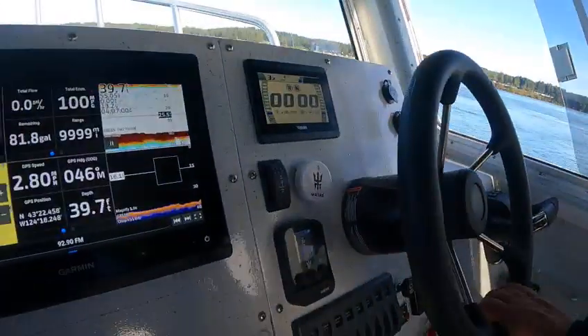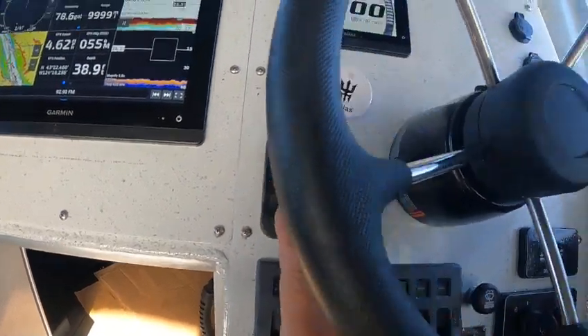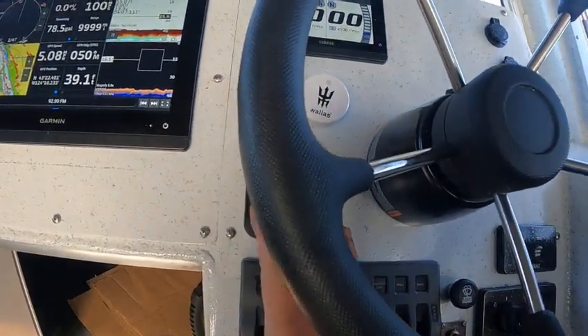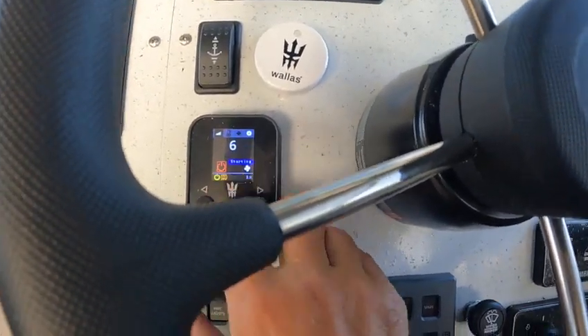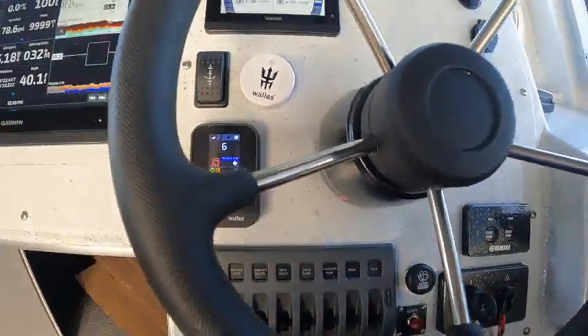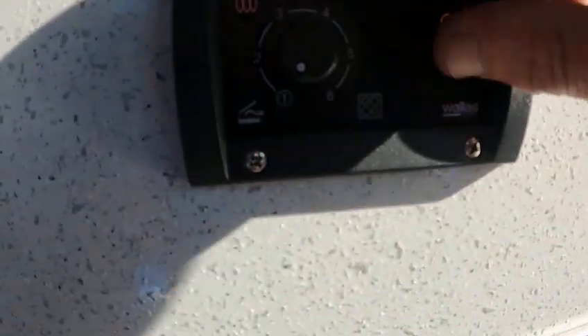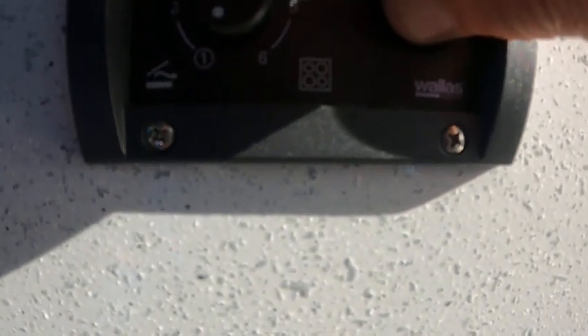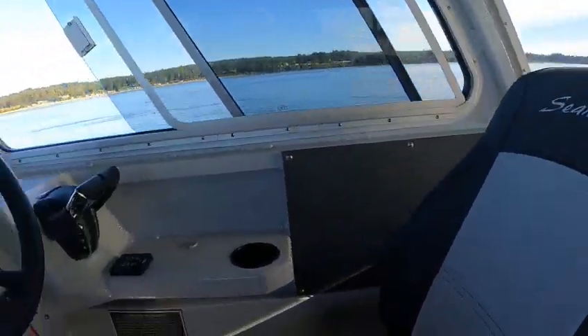Come up here and steer it. Now the heaters are working, I can feel it. See the line right there? I want to shut this — don't ever interrupt this. If you're going to sit there and turn it on — oh shoot, I don't want it on — let it turn on all the way. Same thing turning off: hit this button until it gets down there, just push this one long press, leave it alone, and back here you can feel the heat. See the lights right there? Again on this one you got to push until you see them flash until they go off. Leave it alone — that's going to be red until those go out before you shut the battery switches off.